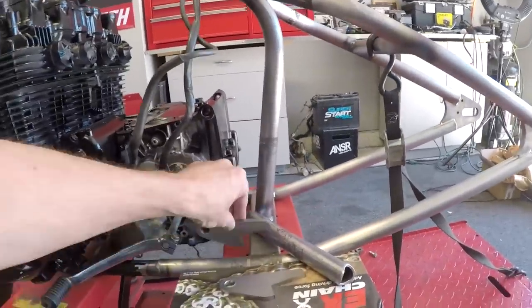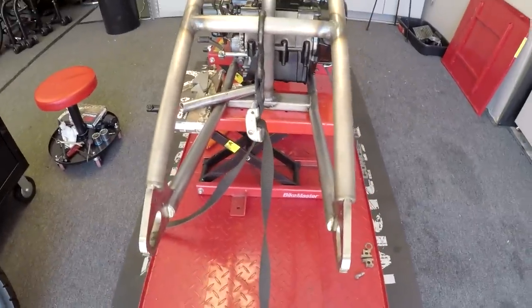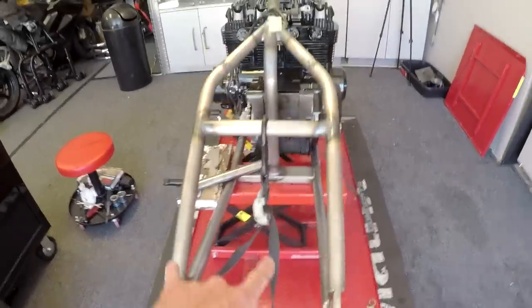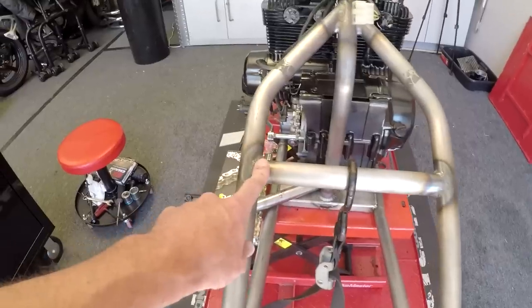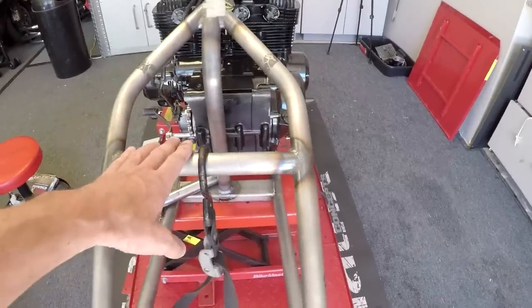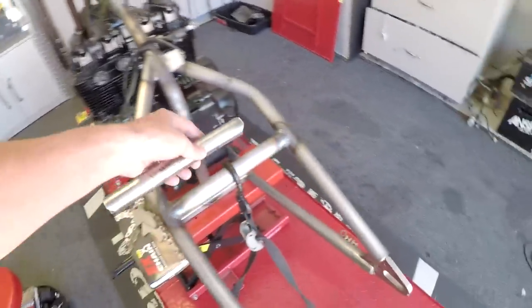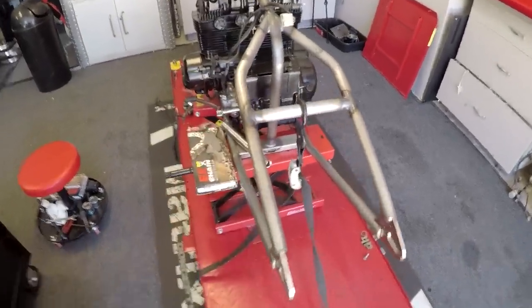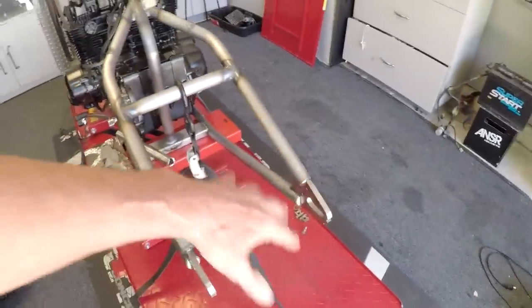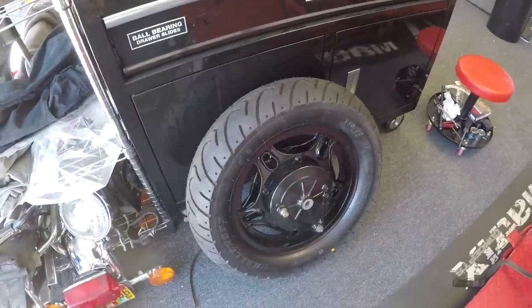I've got to get these motor brackets welded in back here. This right here is a half inch too tight, so we've got to fix that. This is also in the wrong place — when the hardtail frame came in, this was already tacked in place totally in the wrong position. I'm going to cut this one out and put in a new one. The guys over at VU2 Vintage sent me a replacement pipe, so we're going to move this up, get the back wheel back on, and roll this thing into the metal fabrication shop. Part of this process is making sure the chain is lined up with the counter shaft sprocket.